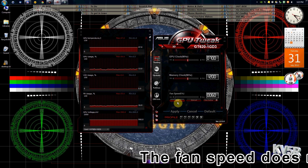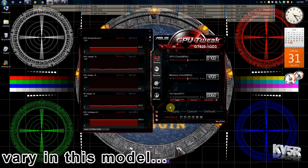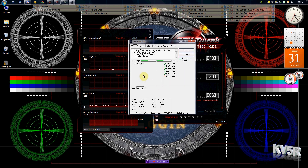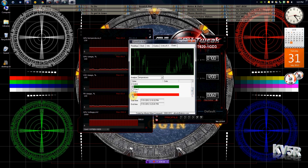Let's see what it's saying about itself — the GPU temperature is at 47, it hasn't even brought its fan up. It is in auto. The processor is at 45 and SpeedFan is controlling it. Let's graph Core 0 on the processor and graph the GPU temp. As you can see, when I was doing all of that slewing in that video, the CPU peaked above 50 and the fan came up, and the GPU has come up from 45 to about 47.